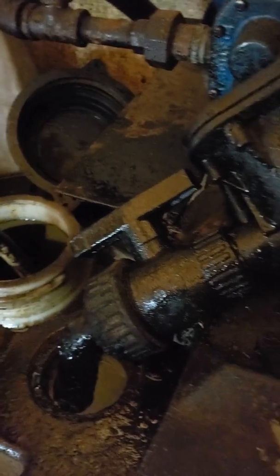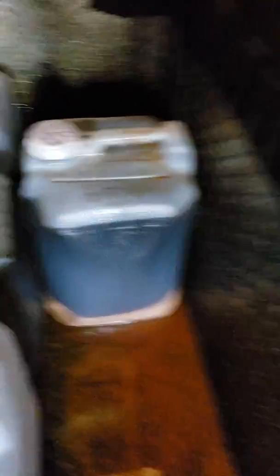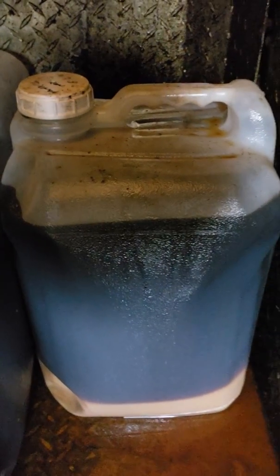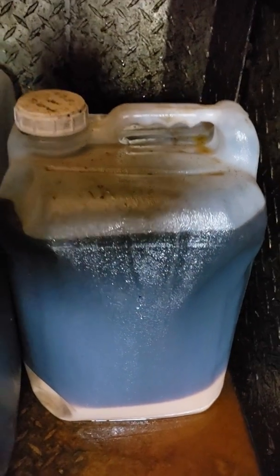It's going to get really loud, but I'll demonstrate how I pump oil. I'm going to pump oil right into my tank instead of from my jugs, because this one here has bad stuff on the bottom — probably water and who knows what else. But on top, that's good oil — there's nothing wrong with that at all. You never want to suck oil all the way down to the bottom when you let your jugs settle. Just go about halfway or three-quarters of the way down and call it good.